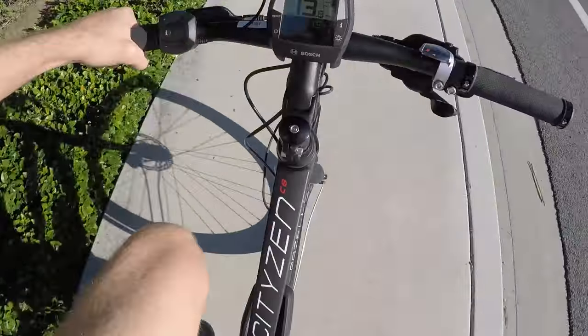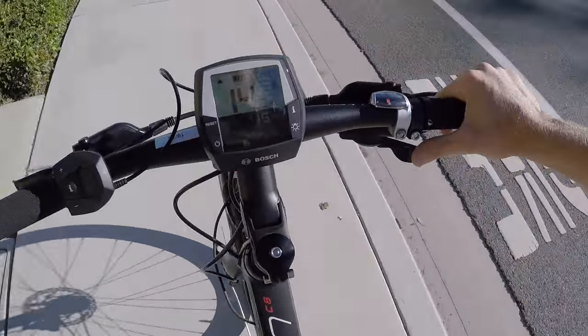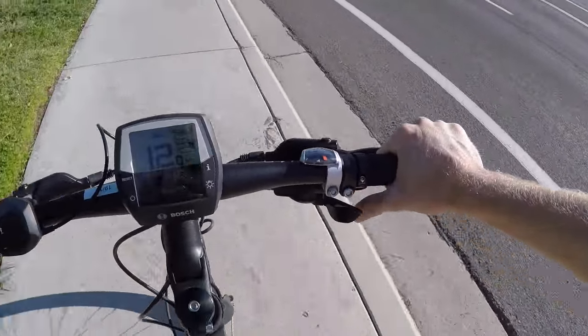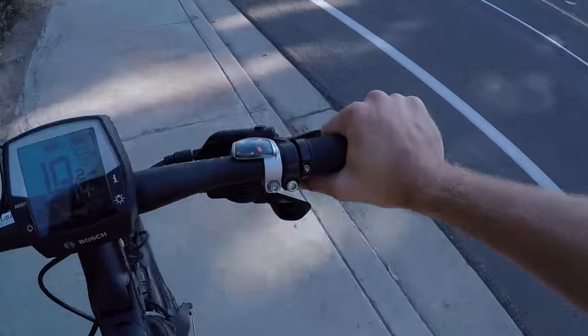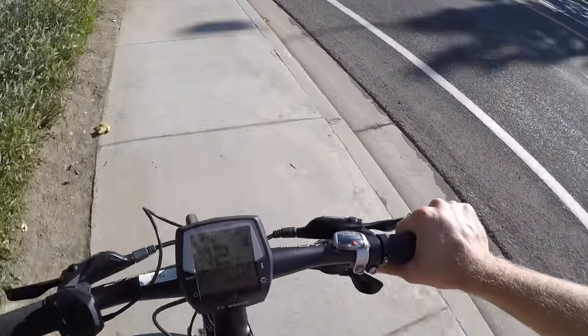The display is saying to shift up — you're pedaling too fast, you could be more efficient. One thing I noticed with the triggers is that when you're climbing and trying to shift gears, the big one is harder and the small one is easier — usually that's the opposite on bikes with derailleurs. It didn't actually shift right away because the system was loaded with a lot of pressure, and it was trying not to grind gears. It waited until I slowed down and eased off. One big benefit of an internally geared hub is that you can shift at a standstill, though depending on the situation it may not shift right away.